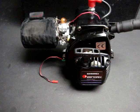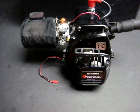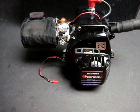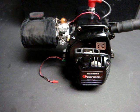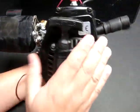Most of the smaller nitro trucks you see in your 8-scale and 10-scale cars are actually starting to go to battery now, because batteries and motors are a lot more powerful. Battery technology, especially lithium polymer, is able to run a lot longer than they used to with nickel metal hydride.